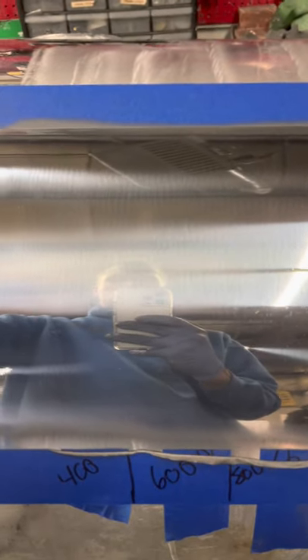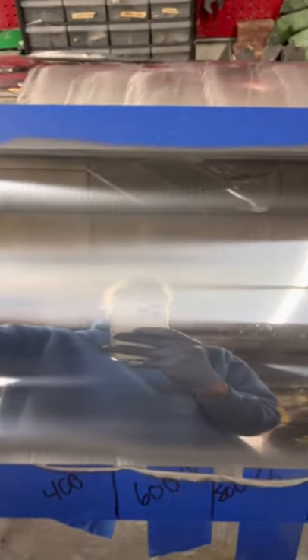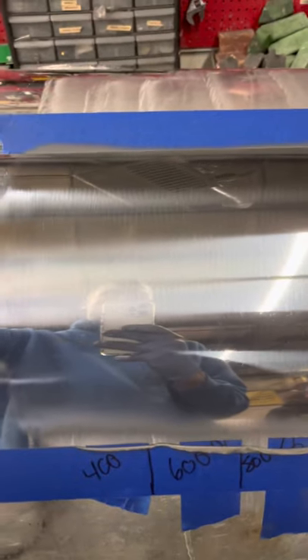There's a lot of LED light in here so we'll roll it outside when we want to show you the finish. But 400, 600, and 800 all look exactly the same. Honestly, 600 cuts a little faster for me personally when I'm doing stuff in the shop. So for me, 800 is a waste - but 400, 600, and 800 all turn out the same, so why waste the extra sheet? As soon as you get to that 1,000 there's a very sharp line. You can see a bunch of little white spots - those are all going to turn black. That's from the pores being completely closed. Once those pores are closed up it doesn't want to accept the polish at all.